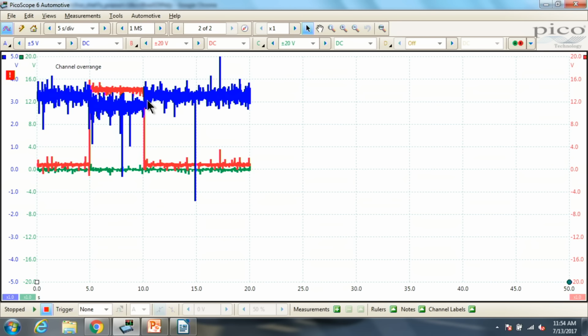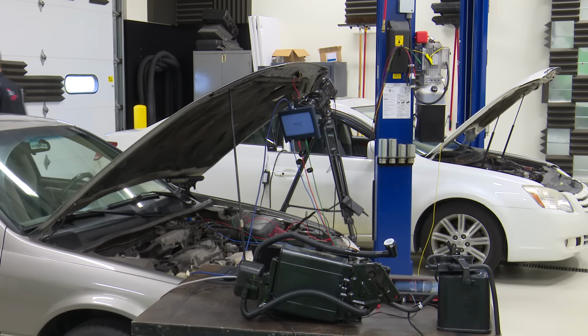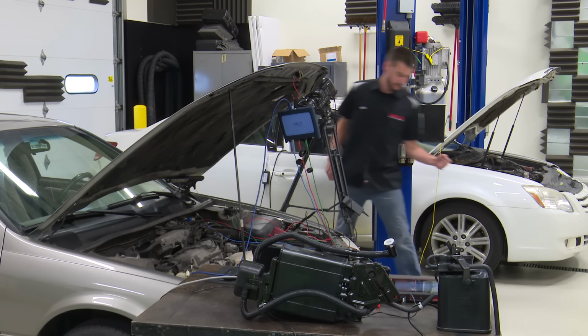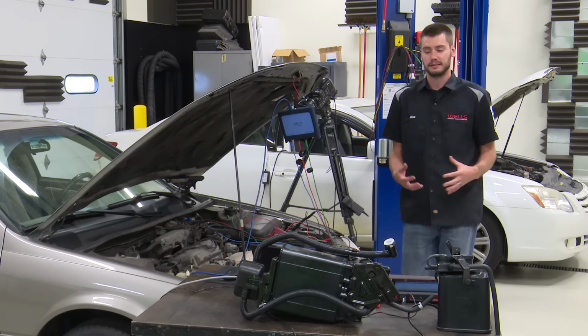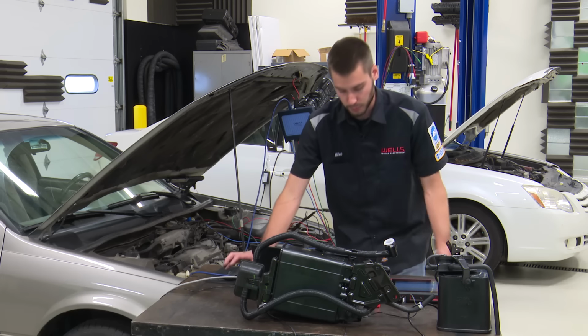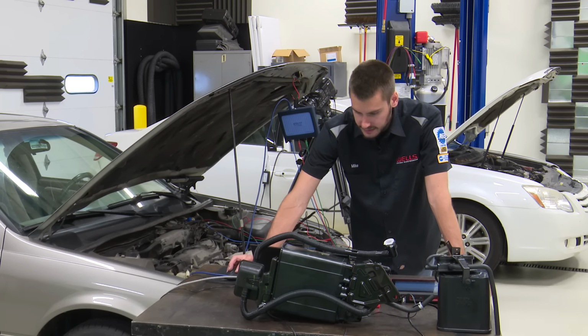Now this thing is not going to run a leak test with it running. No, I take that back. It's not that it's not running. It's not going to use the purge solenoid again to draw vacuum on the system when it's running, because like we talked about earlier, the purge solenoid will not draw vacuum on the entire system. So don't think that's how it's being checked. It's being checked by that natural buildup of vapor or pressure inside of there. Okay, so I think that's it.